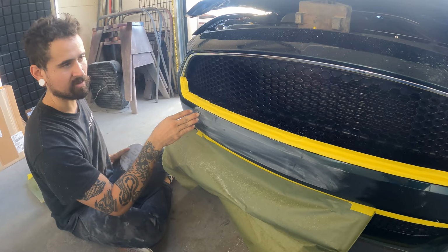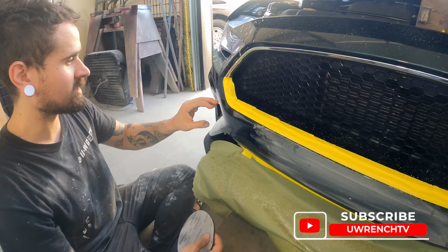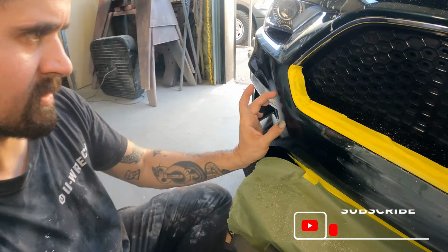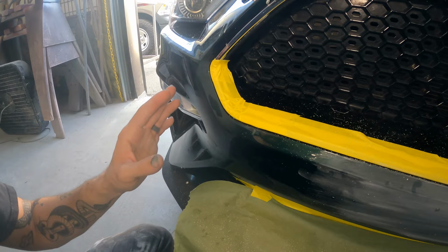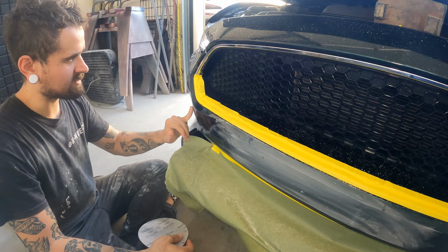So the areas over here on the sides, where I'm going to be burning the new clear coat into the old clear coat through this little area, I put that in 3000 grit. A lot of people just do a step one abrasive compound. I don't generally like to do that. I feel like you can still get away with the 3000 grit, and